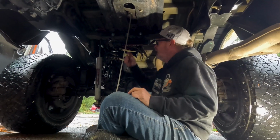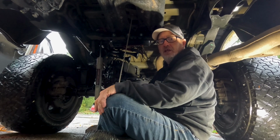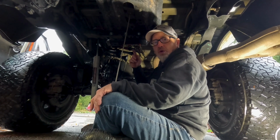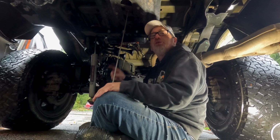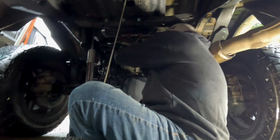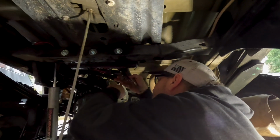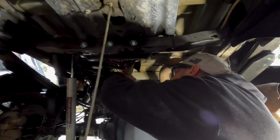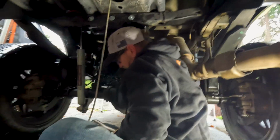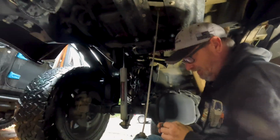And so what we're doing now is the tank that we put in last time, it's got an air gauge on it. We're going to eliminate the air gauge, and we're going to use that port on the tank for our output to our air fitting that's going to be on the rear bumper. This might get loud here in a second because it's full of air and I'm unscrewing the fitting. There we go. Jesus, blew that all apart.